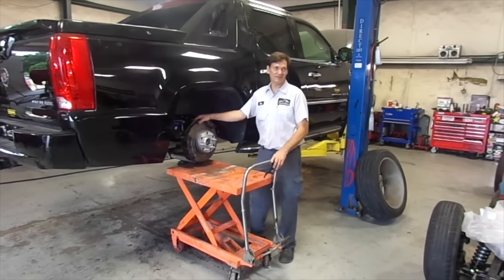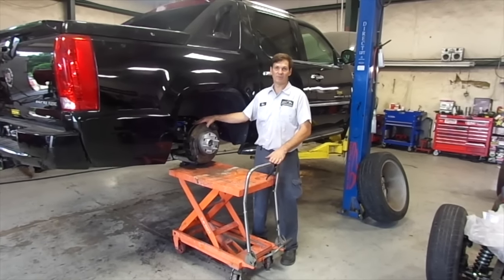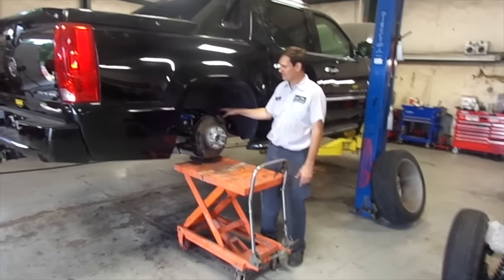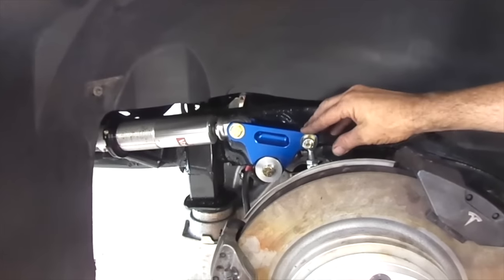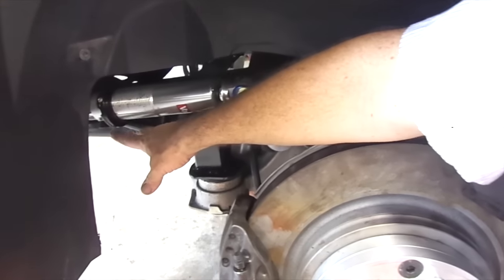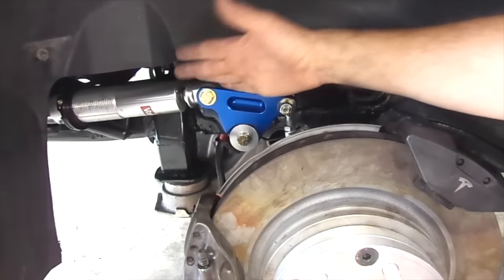This is Mark with Impatient Creations and EVTV. We're here this morning to talk about the 2008 Escalade Tesla conversion. We've gotten all the major weldments done and we have our chassis painted now. We've also got the Tesla unit actually bolted up permanently into the vehicle. We'll do a quick demonstration of the cantilever system and shock. We've gotten our rear shock mount welded permanently on there. This is a dual adjustable coil-over shock — it has two knobs which allow us to adjust the compression and the rebound.